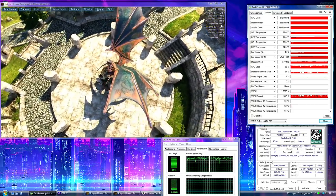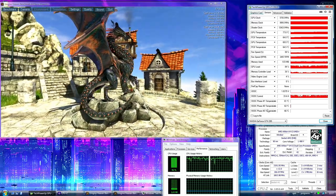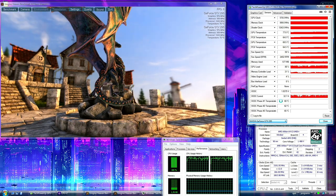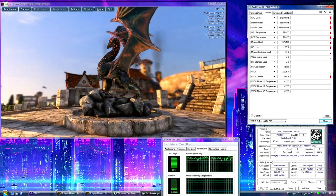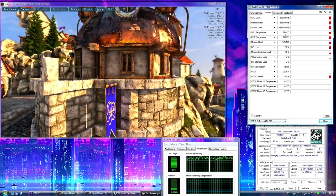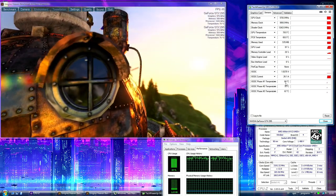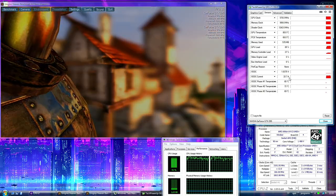So we can see the temperatures here, around 80 on one GPU and 77 on another. I think it's going to keep rising a little bit more, but it is pretty cold inside today, so it might not go higher. Also, as I said, going 1080p is probably adding another 4 degrees on them. And this is the other GPU, you can see here. It just dipped a bit because when probing it, it halts for a while. You can see it's a bit hotter than the other one. And we can see the current draw here. I don't know how to measure current, if that's per phase or total, because if that's total times voltage, that's not a lot for a GPU, but 30 to 40 watts.